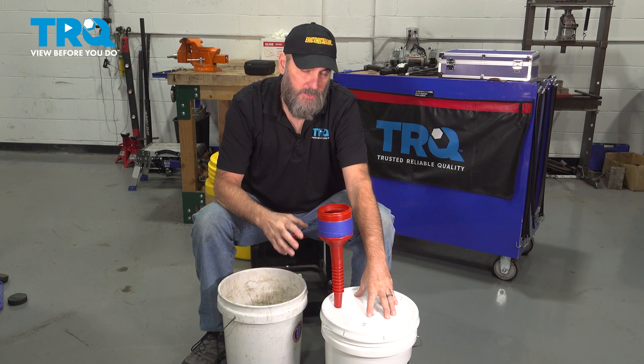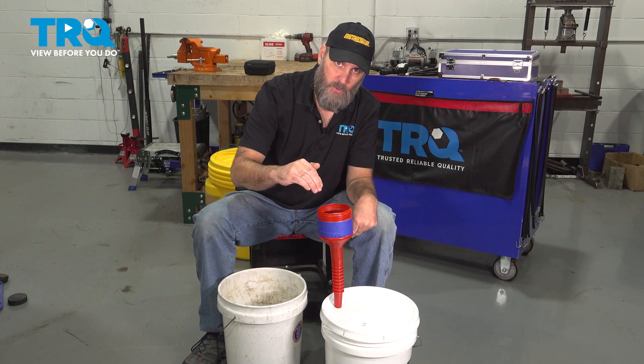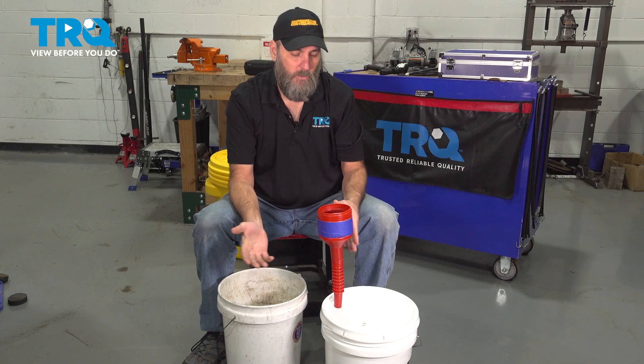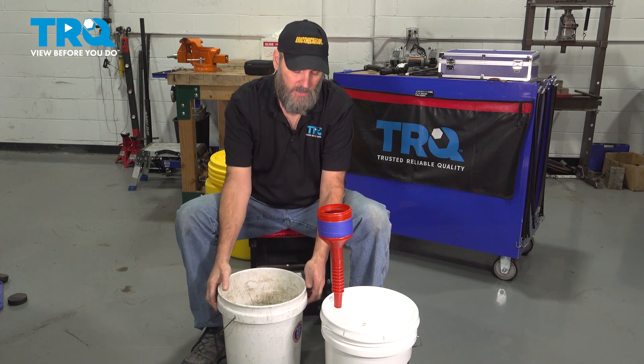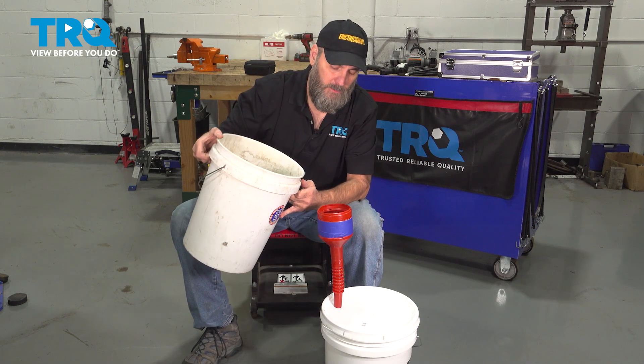The issue you're having is that the air inside of the fuel tank — which I'm going to say is represented by this bucket — is not able to escape as you're trying to put fuel in. Therefore it won't allow fuel to go into the fuel tank. So if there's no vent, there's no way fuel is going to go into this bucket, and I'll demonstrate that here. This is water, by the way.